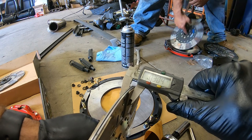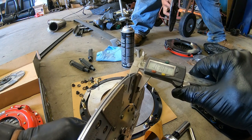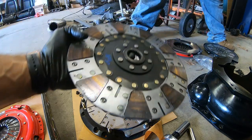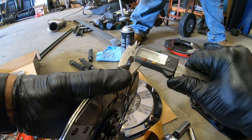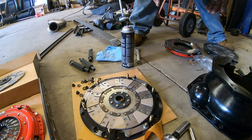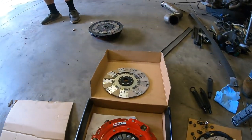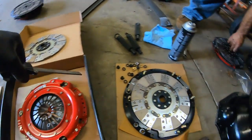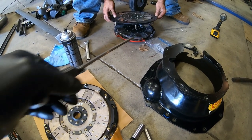Top plate is not as big as the bottom plate. The new one measures about 0.3 of an inch — a third of an inch. Let's see what the wear is on the used top plate. Wow, 0.290 compared to brand new — that clutch is still good, it held for the most part. Anyway, we're going to RMA that one and get it made into an HD RXT 1200, and we'll keep this one as a spare — probably put it in the Steeda clone I'm about to do.